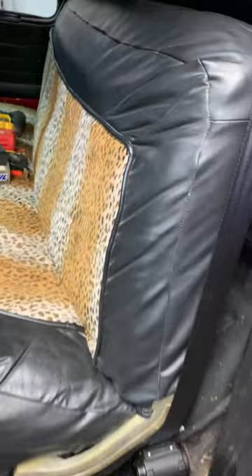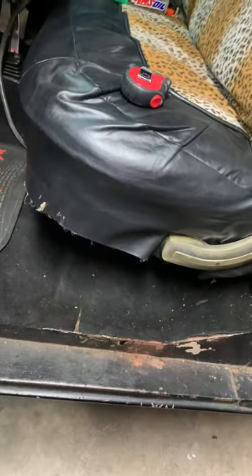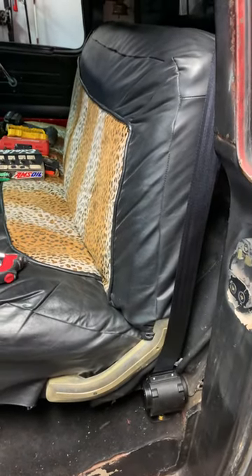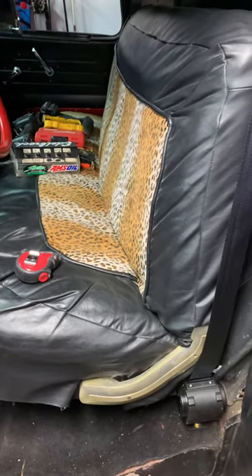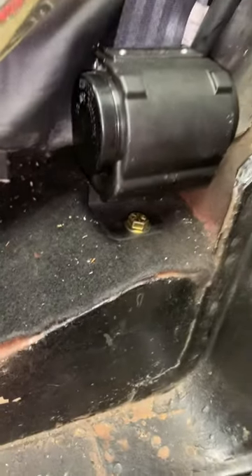The other side is already done. My next step was that the bench also wasn't bolted down, so I had to build a frame to bolt it all down and hold it together, then put in the mounting hardware for the seat belt receivers. Pretty straightforward — it's just fab work, bolting it all together with grade eight bolts. Having a kit with all the grade eight hardware is very helpful.